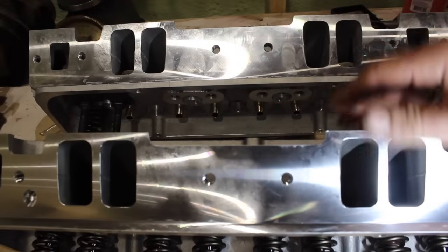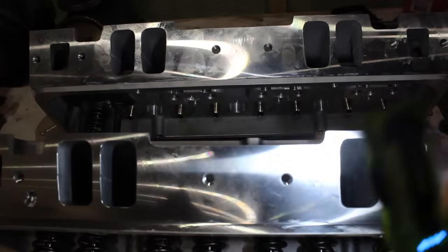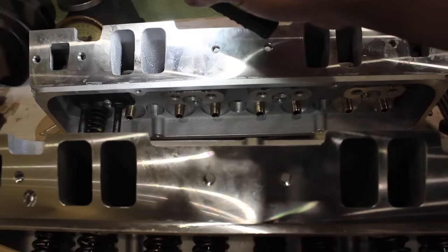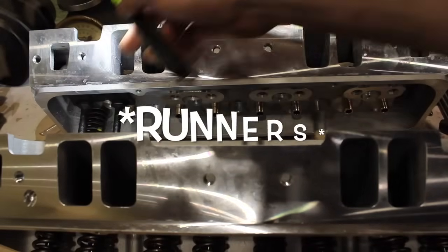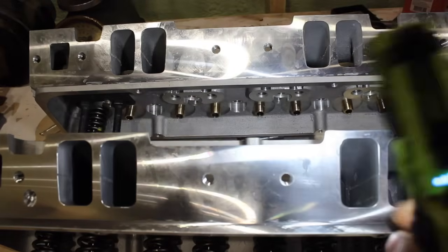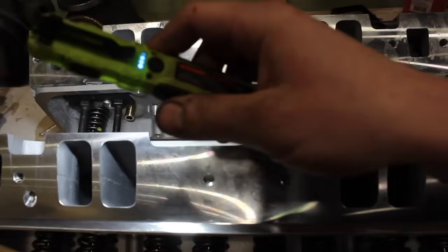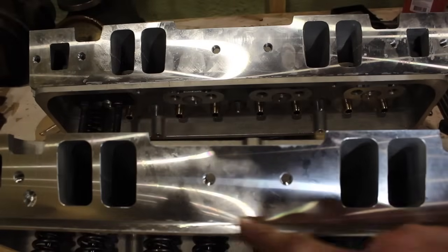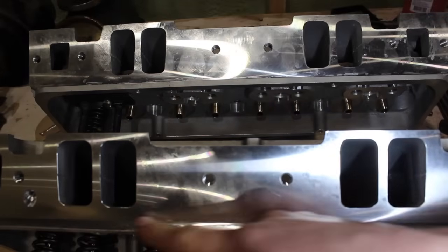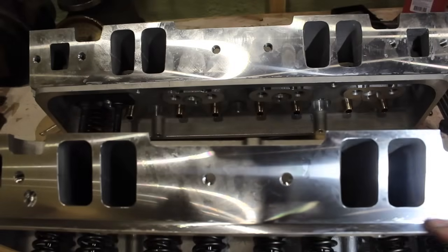Both are fairly good castings, but I do notice the AFR is a better casting. There's quite a bit more slag — you can probably see that if I get the lighting right. There's quite a bit of slag in the cylinders on the Amazon DNA heads versus inside the AFR heads, where it's a lot more smooth. The machining is very similar, though this one has more of a lip and this one looks like they machined it off — you can kind of see the milling marks.